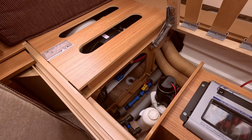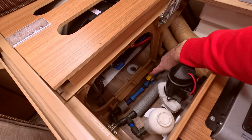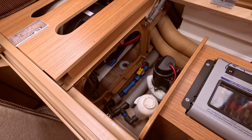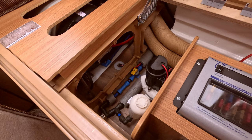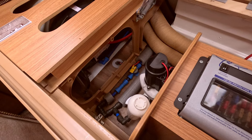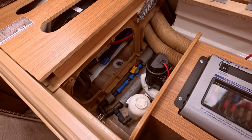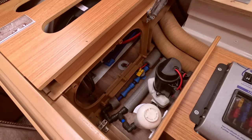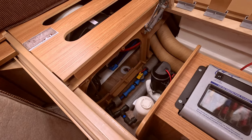One of the other key areas that I've mentioned before is just remember that you've got your water valve in the closed position, as it will have been left for the winter. You would normally have that open to drain the system down. I've been there before, pumping water in, thinking this is taking a long time, and then realizing all it's doing is pumping water in from the barrel and then straight out the bottom of the caravan. So just make sure that this is in the closed position, but again, this is going to take a few minutes to fill up, and then obviously that will switch off.